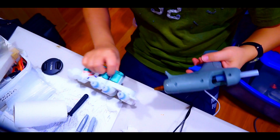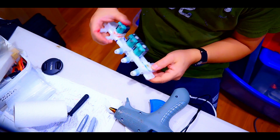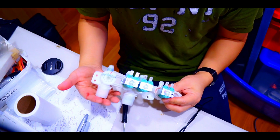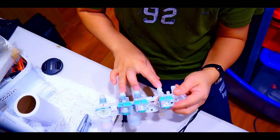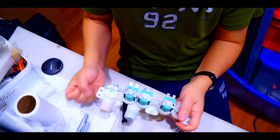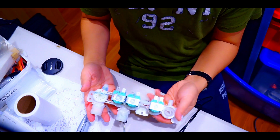I'm sealing it in completely. It's done — I sealed this part here and the top as well. I will not connect the hot water hose. The cold water hose will flow into the cold water valve but will not flow into the hot water valve which was leaking — we sealed it. This is a temporary solution to get at least the washing machine working for cold water washing. I'll wait till next week for the new original part to arrive.